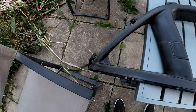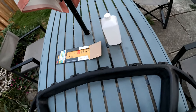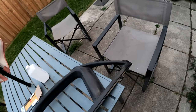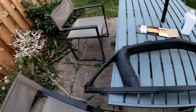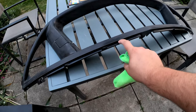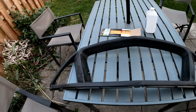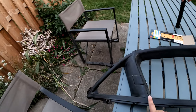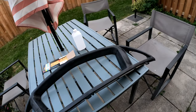I finished wiping it down with paper towel and rubbing alcohol — it's very smooth. Plan is one coat of primer, probably two coats of paint, and one or two coats of clear coat. I also wiped down all the hidden areas since sanding dust goes everywhere, and the isopropyl leaves some fibers behind, so I'll give it a final dry wipe with the microfiber cloth.